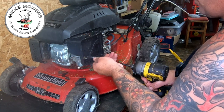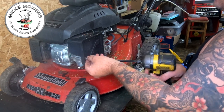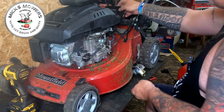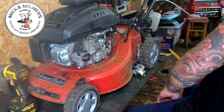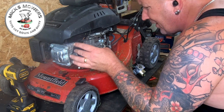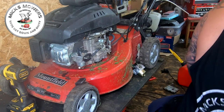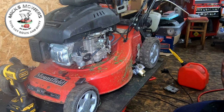All I want to do is remove the carb - I'm hoping for a six pound fix. If this proves to be successful then we can all go forward and buy some of these which will replace the LHP19 carb. The one thing I can see that's different is I believe the spring on this one. Yeah, this throttle's got a spring on it. I need to make sure this carburettor is actually going to fit the machine - at the moment there's no guarantees, it may be the wrong carb.